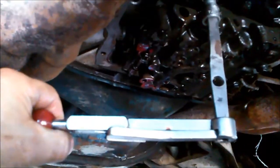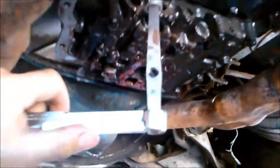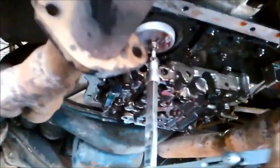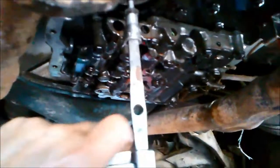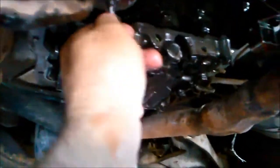So we'll just pull the pin back in and back off five turns: one, two, three, four, five. And just do up that lock nut. The band's very worn in this one.